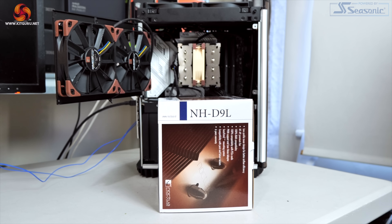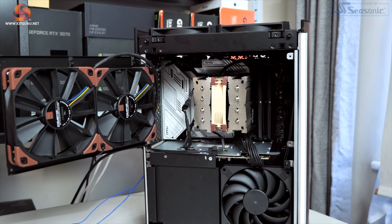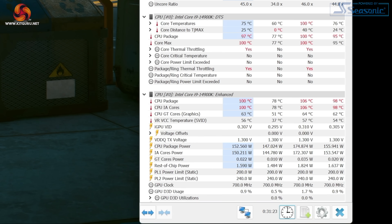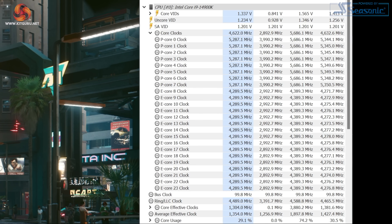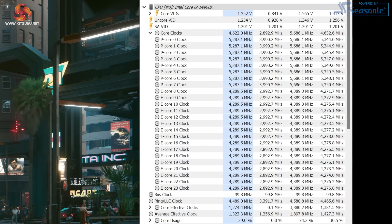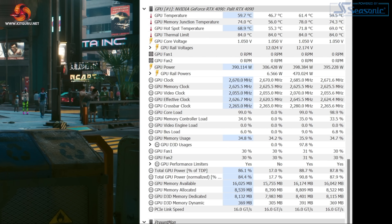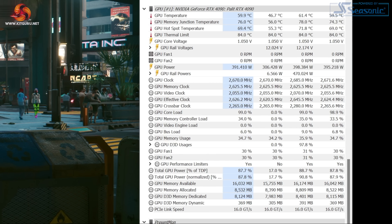In a similar vein, I also wanted to see what difference it would make if we used an entirely different CPU cooler, so I took Dubow's suggestion and grabbed a Noctua NH-D9L. I did actually want to try the U12A but it was just slightly too large so I settled for the more compact option. Even with those same 25mm Noctua fans installed and the NH-D9L cooler, I actually saw worse thermals than with the 120mm all-in-one. The CPU hit 100 degrees peak during my testing in Cyberpunk 2077 and was regularly in the mid to high 90s, and was even clocking slightly lower — so this is definitely worse than the stock configuration. The GPU thermals were barely affected, which suggests to me that the 240mm all-in-one is doing its job well and would be no problem were it not for the uncovered VRMs.